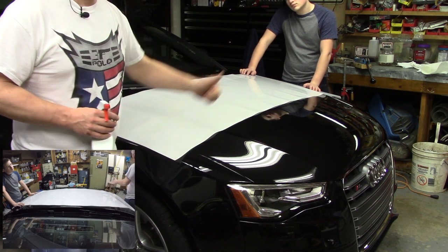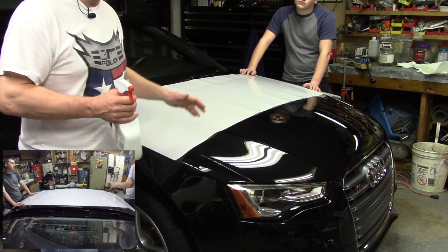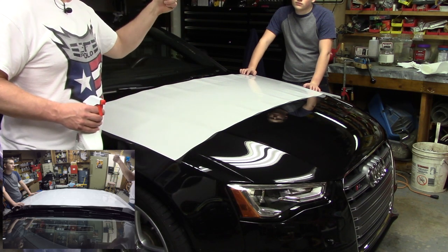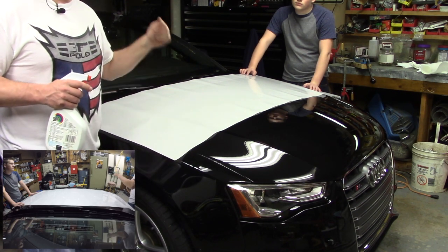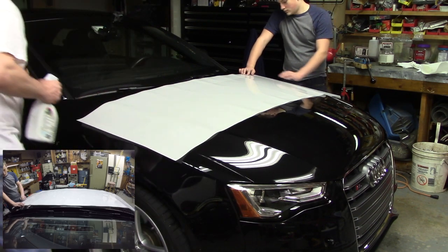I will then use the regular spray alcohol, water, and soap solution over the top for my squeegee, but underneath it I want this little bit thicker solution. I've got my son here helping me. You can see how wide it is. You need to hold this up after you peel it and keep it from touching anything until all of the surfaces are wetted down. Because once it sticks, it's not going to want to come off. All right, so here we go.